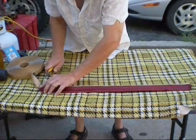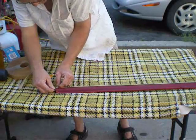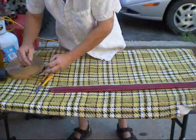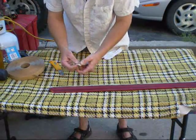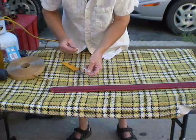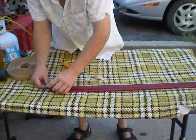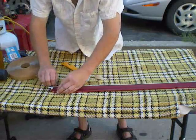So I'm just going to cut that off there. It's a little tricky at first when you start to peel the backing off — it tends to all want to come up. But once you start it, it comes off just like that. I'll cut another little piece just for the edge here. Once I put it on with the rivet it's going to squish out a bit and there will be some visible, but I'll just let that settle for a couple trips and then trim it all off. You want butyl tape anywhere where there's going to be a hole — where there's going to be a rivet going through the trailer.